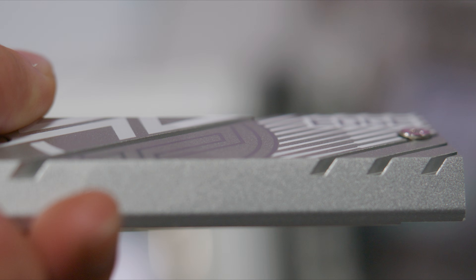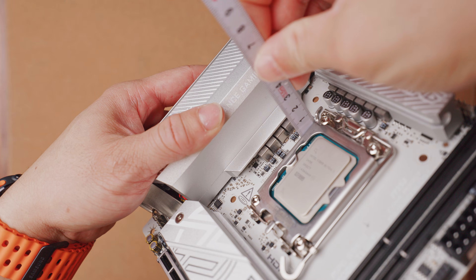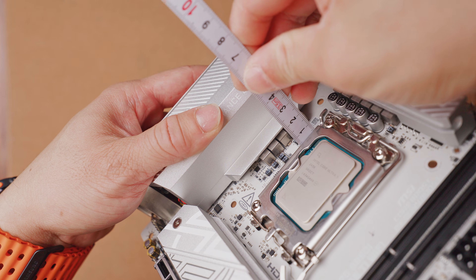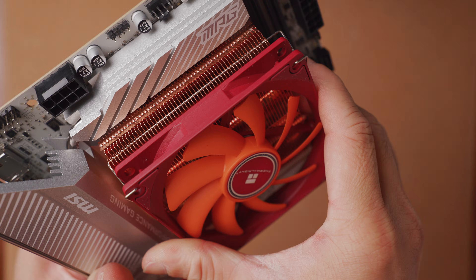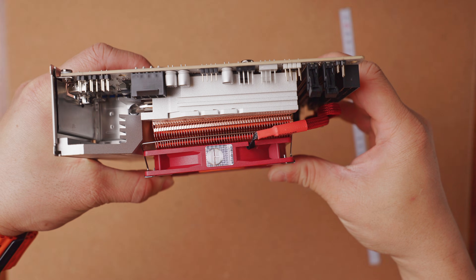This top metal piece really is just touching your drive, and that's a Gen5 M.2 spec. For some builds this is very important, because this board simply will not work with certain cooling systems. I'm not sure why they designed it this way, but the height of the IO-side heatsink is just a bit too much. For example, with coolers like the Thermalright AXP90, which is a very common cooler for an ITX build, the wider base footprint will cover this area and the cooler won't be able to mount because this is higher than the CPU height. Most tower coolers and AIO cold plates should be okay, but it is a very odd design choice given that this is a mini ITX board and many users will be using a cooler like this.